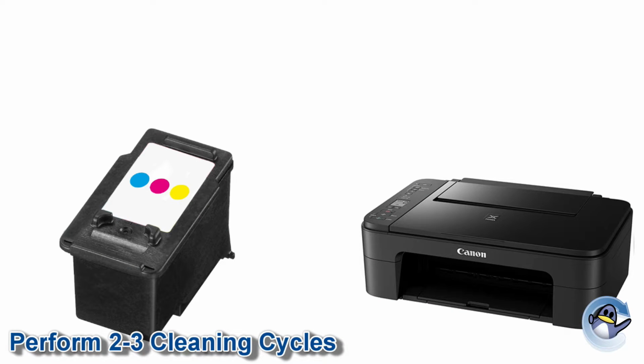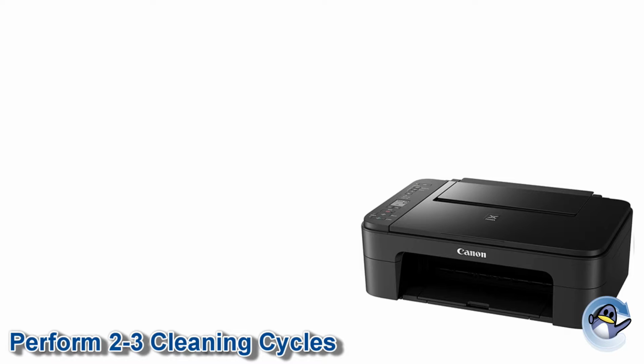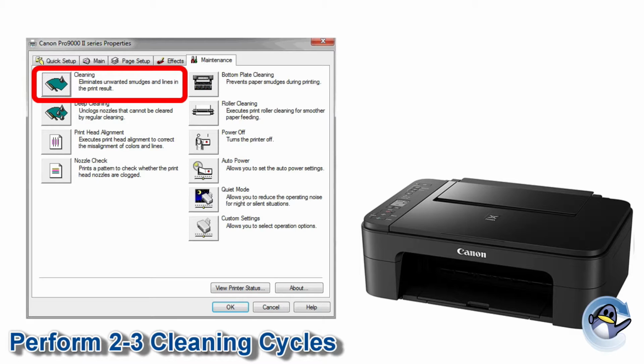With the refill complete, reinstall the cartridge and perform 2 to 3 cleaning cycles using your printer or printer software. If you're unsure how to do this for your particular model, please consult your user manual.